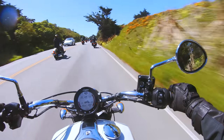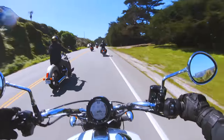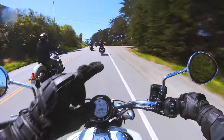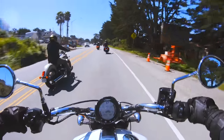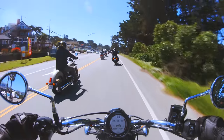It's like a little bit of resistance, and that is one way to cut it off, where you can pull the clutch in. It's a little bit more abrupt. You can cut it off, or you can hit either the front brake or the rear brake and knock it off as well, or you can press the button. So there's multiple ways to cut the cruise control off, but that is, again, one big thing that many people have asked for Scout.